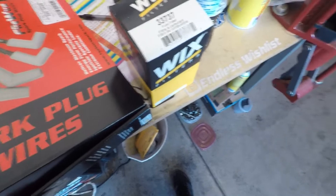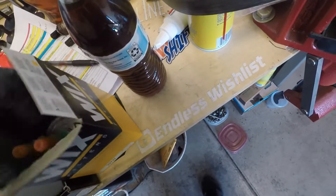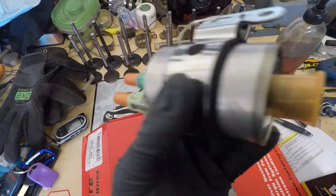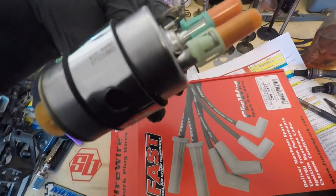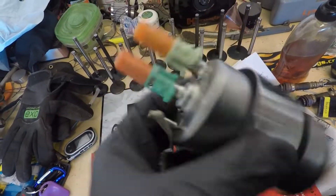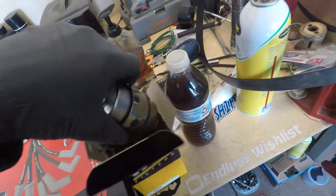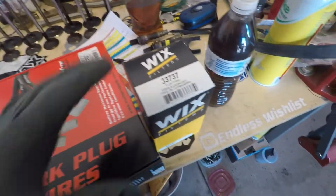The fuel filter we're going to use for the intake swap — we're converting the return system to a returnless system, sort of. As far as the fuel pump and tank goes it'll have a return, but to the manifold it'll just have a feed. This is a filter from a Corvette C5 or C6 — it has a regulator built into it and whatever it doesn't need it sends back. Don't worry about getting the numbers just yet; I'll have everything put together before I start the intake swap so you can see everything you need.